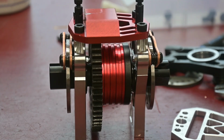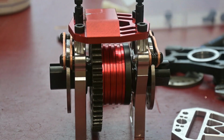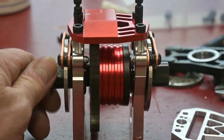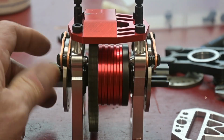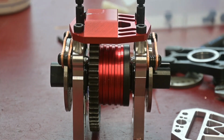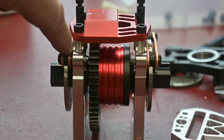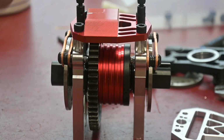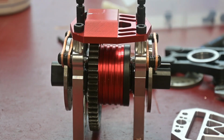So the discs, I got them out of the lathe now. I've cleaned up, deburred, and well, it's nice and smooth now. It would just completely bind up before, it was a no-go. It did take quite a bit of material off there. And I guess, as we were saying earlier, you definitely got to have 6.5 millimeter, thereabouts, holes in those inner brake discs so they can slide in and out without binding up.